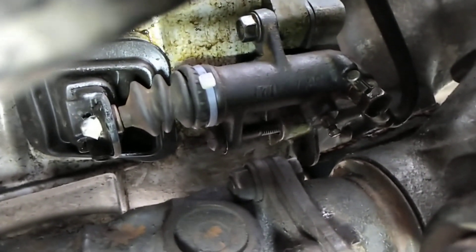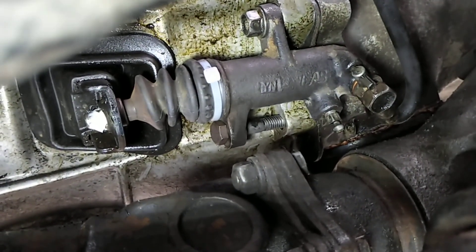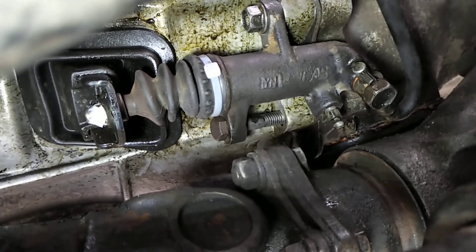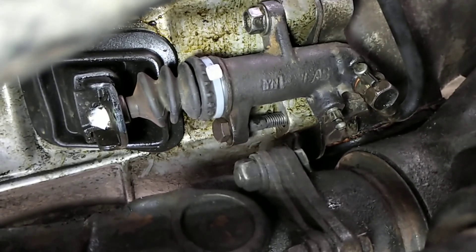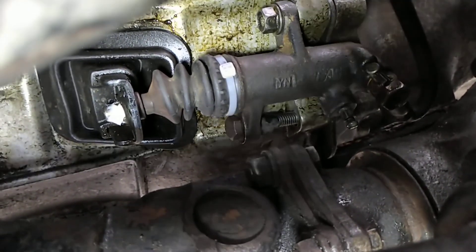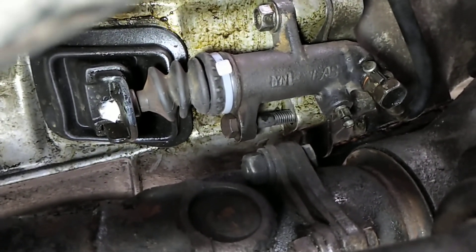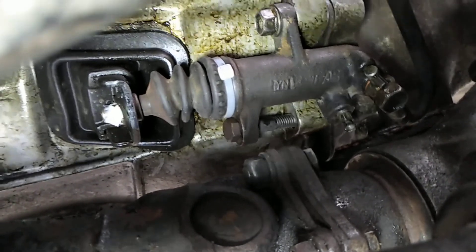In the meantime I tightened down the top bolt, which is the proper mounting bolt, as tight as hell — that one is on there strong. And I've just bled it a few times by myself. I'm definitely lacking an evacuation kit, a one-man bleeder kit, so I just did it the old-school way. That's gonna give me enough clutch action to go pick up an assistant, so I'll drive across town and then we'll bleed it out properly.